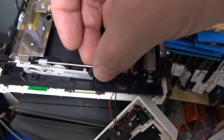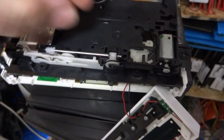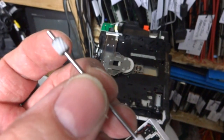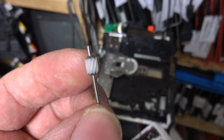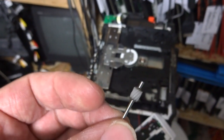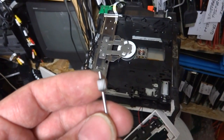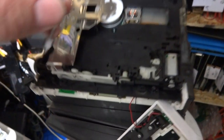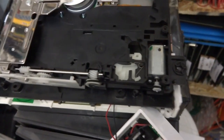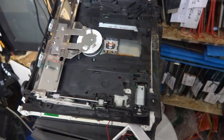I've taken this pole out and used some epoxy on it. I have to apologize - there's some construction going on around the house, so you can probably hear grinding in the background. Here is the post that had the cracked gear. I went around the edge with some JB Weld to try and hold it in place and smooth it out. It seems to be holding pretty well. I let it set overnight to make sure it got a really solid grip. The next step will be to put the drive system back together and test everything out.